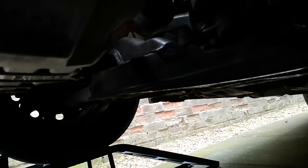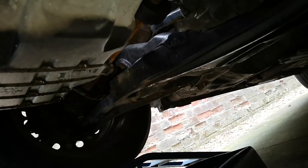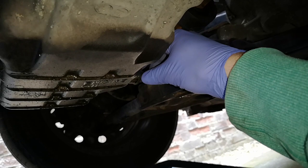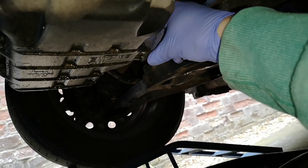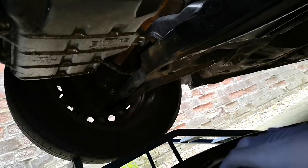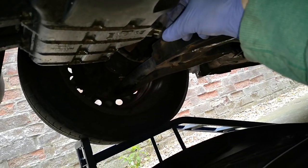I actually ended up having to knock this loose off camera because I needed to use both arms and really put some force into it. These shouldn't really be on that tight. It looks like the oil hasn't been changed in forever. We undo the sump plug and let it drain out. It's worth replacing the sump plug washer or gasket every time you change it, because it avoids oil leaks.